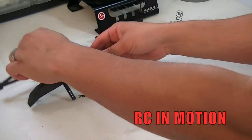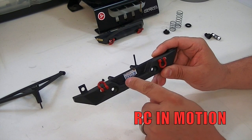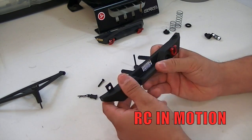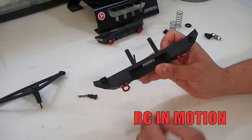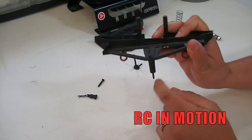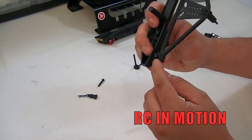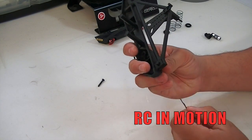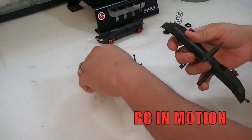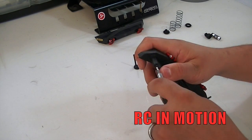For the rear bumper I went ahead and installed everything already, including the little license plate reading 'SCX10 JK'. The rear has a special mount for the spare tire — all it takes is this little mount where you screw in a 2.5 millimeter screw all the way through, which will be the mount for your wheel. Then there's another hole where the bracket mounts to the bumper, held on by a body clip. The other side is held with a 2.5 millimeter hex.